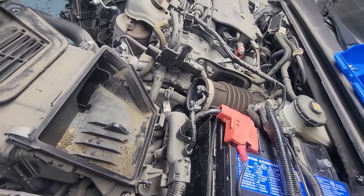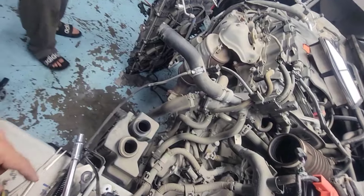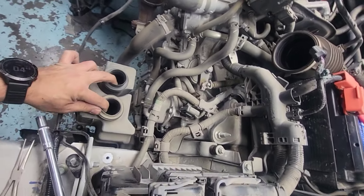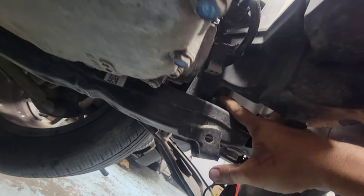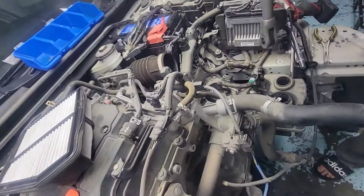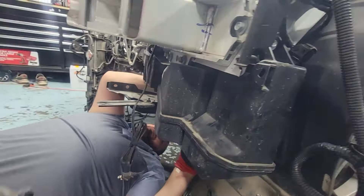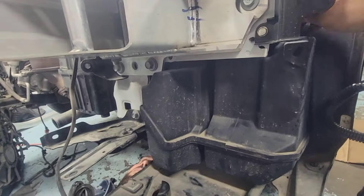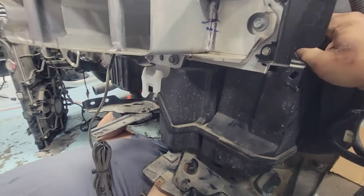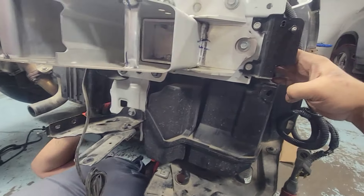Lots of bugs in there. Peel it off — there's a bolt right here you need to take out for that second layer, and then for the third layer there's a bolt here and one down below. There's one up there and one down here, so let's take those out. There's also one on the corner. This is like an intake resonator — this big box right here — it's just to reduce noise from intake air coming in. There are only three bolts total: one on this side and two in the engine bay.